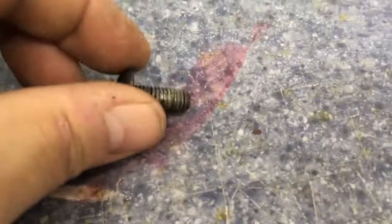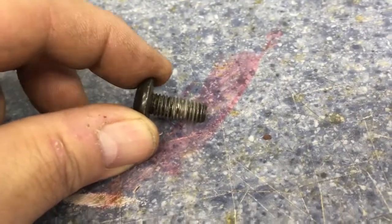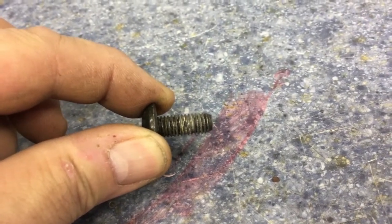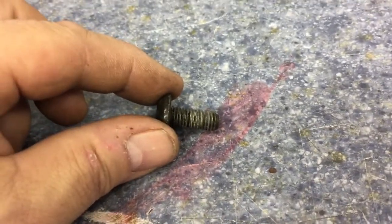There's the factory bolt there. So that looks like it's very close to a 5/16. If I go to a 5/16, it'll be a coarser thread. It might give it enough bite. You don't want it loose. There are 2 bolts in each hinge, but still, you don't want your door getting out of adjustment every few rides. They've got to be in there tight.